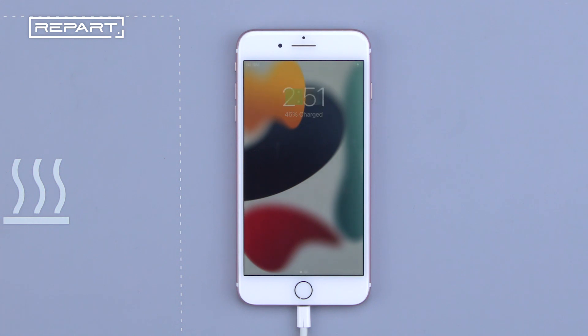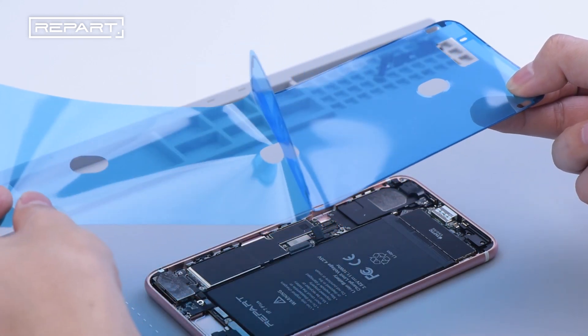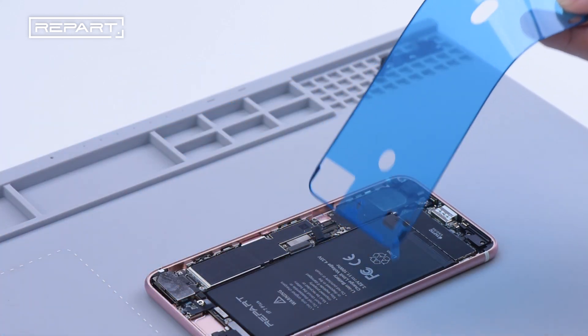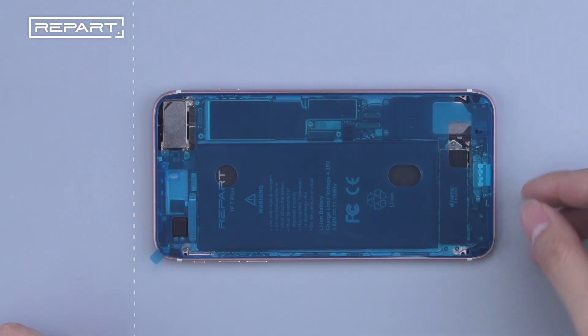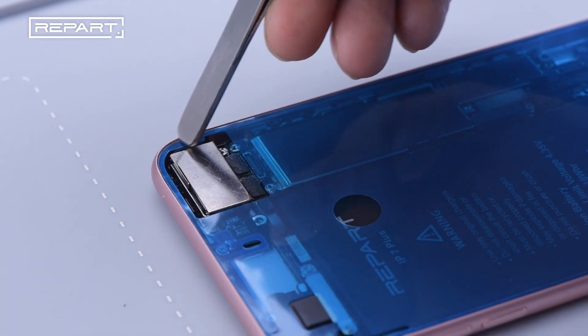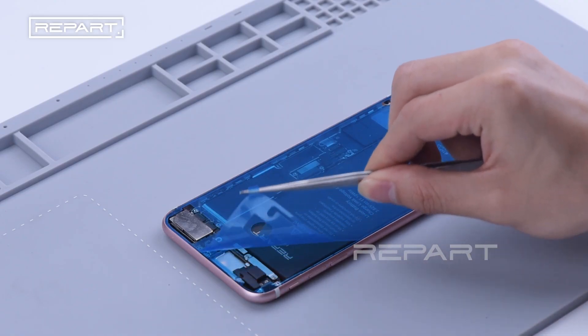First is the wired charging test — it's working. Tear off the waterproof adhesive and make it adhere to the phone body. Press lightly with a spudger to make it adhesive, then tear off the film.